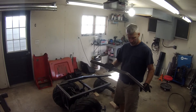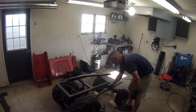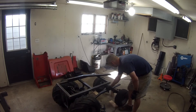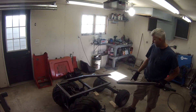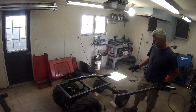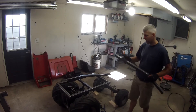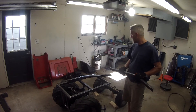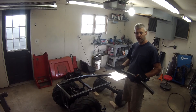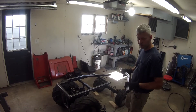We've got our frame rails finished. These will mount right down here like this, put a little kink in and get up over top of that. What that will allow me to do is let that float up and down, because this body will go over rough terrain and I don't like putting all that stress in the framework twisting it. So let's get them mounted.